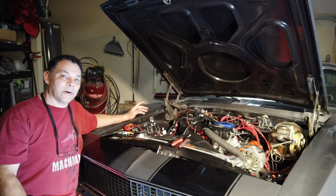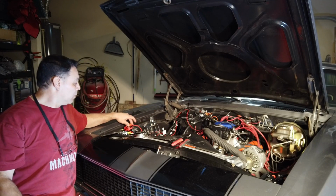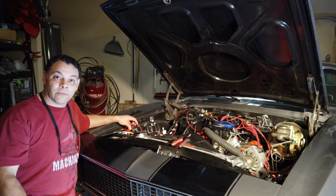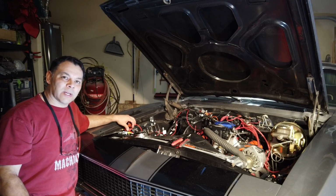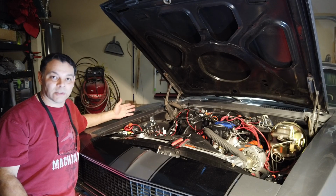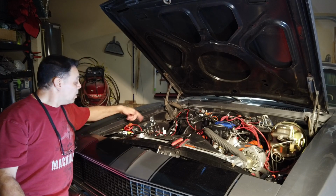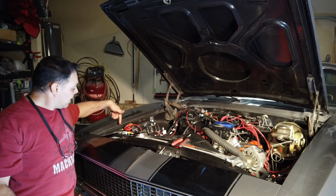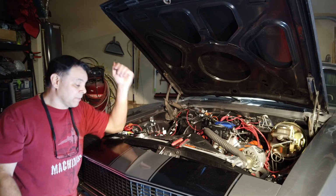So I finished most of the wiring over here and setting everything up in this mounting plate. I'm going to put a little bracket right here to hold on to the remaining wire for my positive and negative leading to the ECU and to the wire harness, because I don't really want to cut it. So I'm just going to store it. I don't really care that it doesn't look fantastic. This is not a show car. It's just a driver, and I'd rather have the extra bit of wire so I don't have to splice in the future. From there, I'm running my pump positive wire. Now, I ran the pump positive wire paralleling the negative that goes over to my FiTech Mini, which is over there.